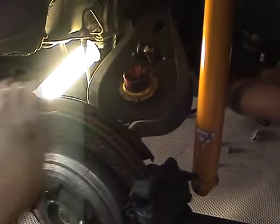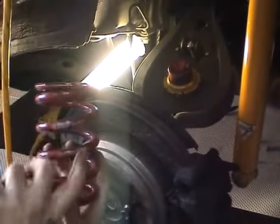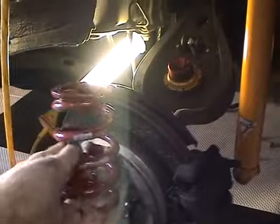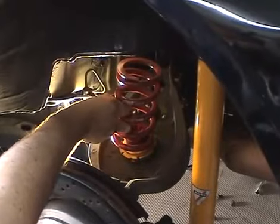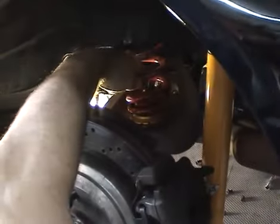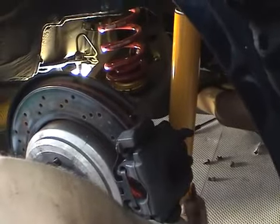This is your spring. Here is your lower ride height adjuster. Here is your upper spring seat. I recommend putting in the spring such that one can read the rate and length of the spring from the side, right side up. Simply lay it in place, push up on the arm sufficiently to screw in the lower shock bolt.